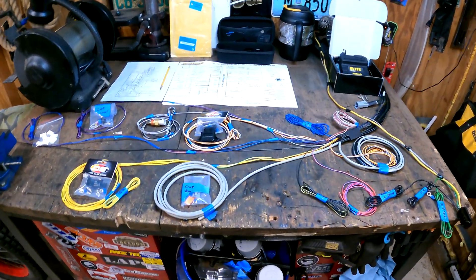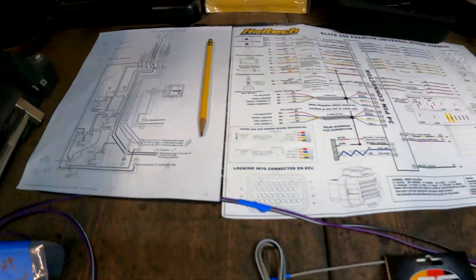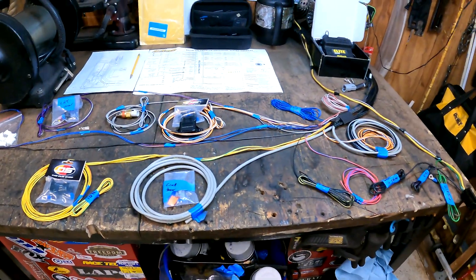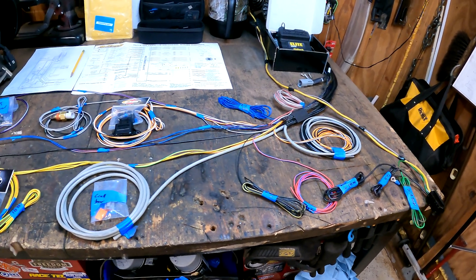Time to dig into the wiring. I've spent considerable time studying the diagram, looking online, looking at the stock diagram, matching wire colors, sensors, plugs, and everything like that. My goal is to get it all laid out on the bench, make sure everything's where it needs to be. I have it laid out in the car — driver's side, passenger's side, ECU location. I have some stuff coming from Wire Care: wire protection, heat shrink, and wire supplies to make it look nicer. I'll get it all cut to length, then shield it, heat shrink it, crimp connectors, and heat shrink those in place.